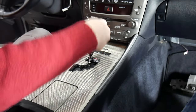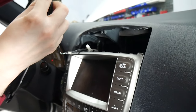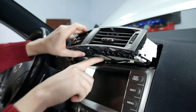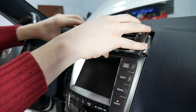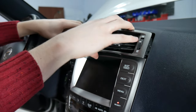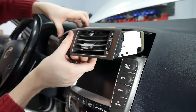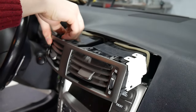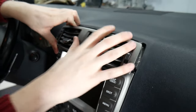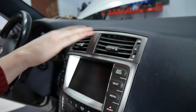Now we'll show you how to put the vent and the glove box back together. For the vents, we've got to plug in these two connectors here. Make sure you get this wire over the top. As you push it in, it's best to wiggle it around and make sure you've got it all in place correctly. Also check the top and make sure all your trim's fully in — it looks like this one actually popped loose up there, so that's where we're having some difficulty.